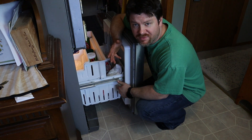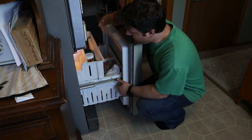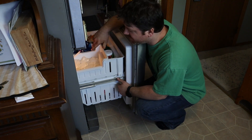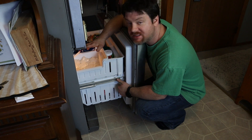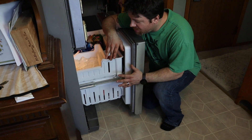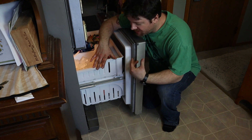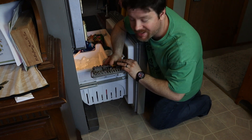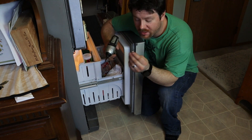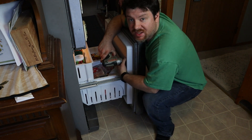If you're antsy like me and don't want to wait, the defrost cycle runs about 20 minutes per test. You can start tearing your freezer door off and getting the trays out of the way so you can get the access panel off. The easiest way to remove the trays — start by getting your socket, figure out which one it takes. I'm using a quarter inch socket and begin by removing these little self-tapping screws.